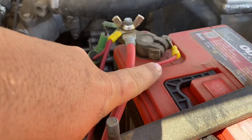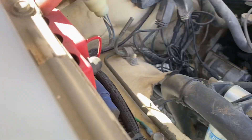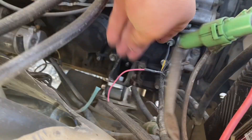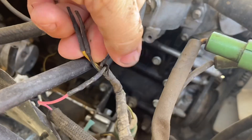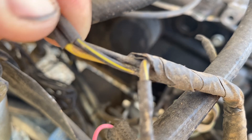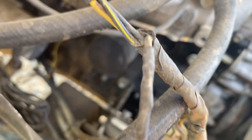The wiring is very easy — it just takes a little bit of knowledge on where you need to go with it. Hot to hot, ground to battery. You don't want to go off a junction box — that's a no-go. This pink wire needs to be 12-volt hot. Inside this splice of wires right here, that black and yellow wire — the one it's hooked into — I just spliced the pink one right into that.